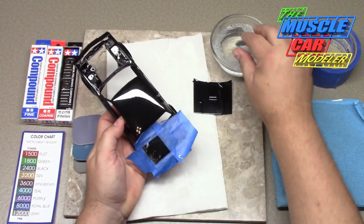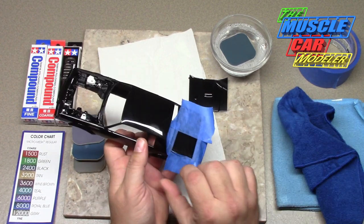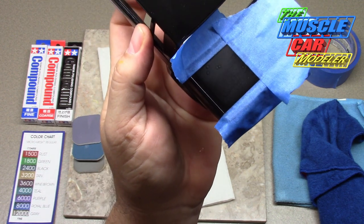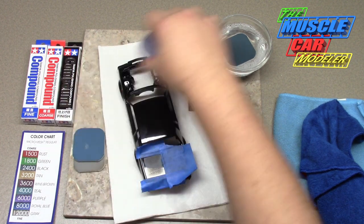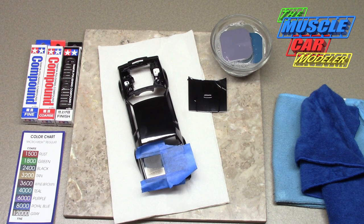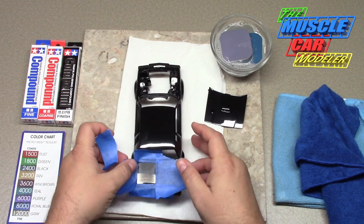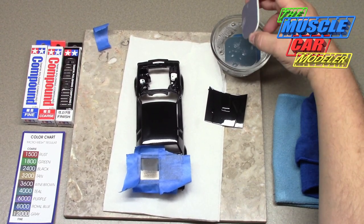This trunk area has some pretty big ones, which is why I'm doing it on this one. Sometimes I don't do it — I may not hit all of them, I may just polish some of them out a little bit. You can see they're almost gone or flattened out; there's just a little bit of depressions. Now I'll move on to the 6,000 grit and get them all wet. You don't have to spend a whole lot of time on this because it'll improve fairly quickly.